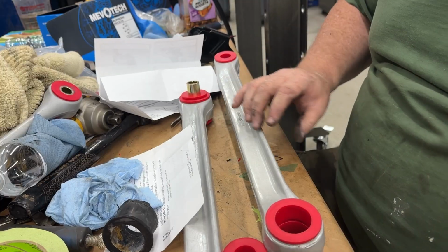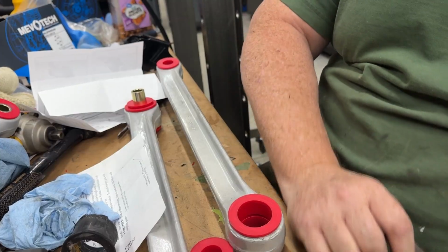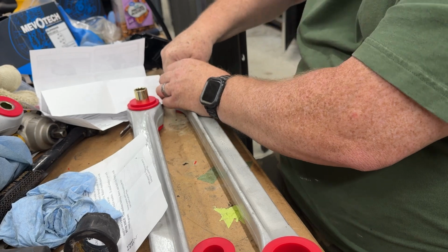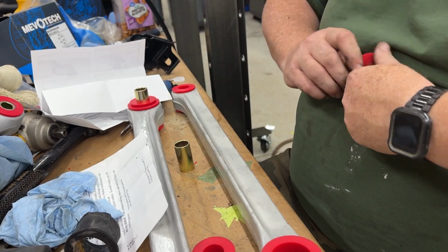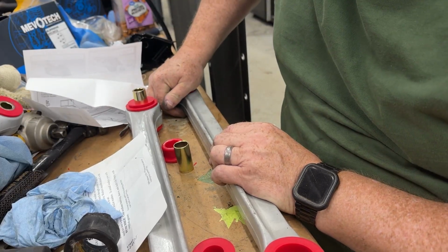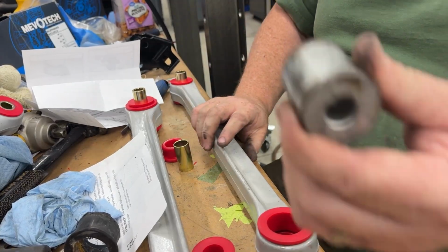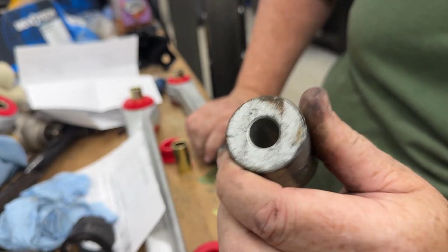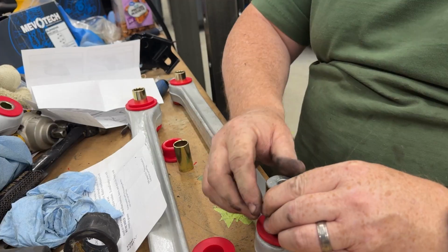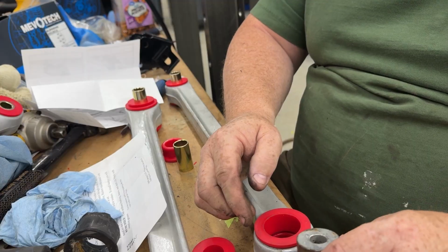Okay, almost screwed these up. So, luckily, I haven't been to the dump yet, but the way this is supposed to work is the smaller, tighter collar. I think this is kind of a universal set. So this collar goes down on the small end here. On the large end, you don't use a collar. You have to use these spacers that were originally supplied from the car. So I still had these in the trash, luckily. And you press these in, and that is that side of things.